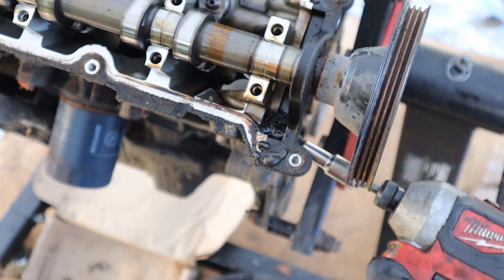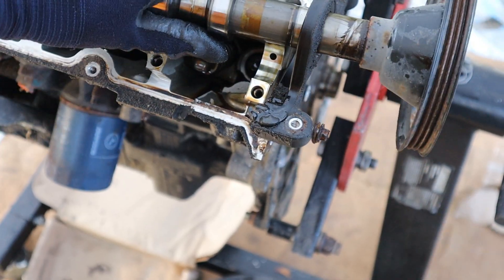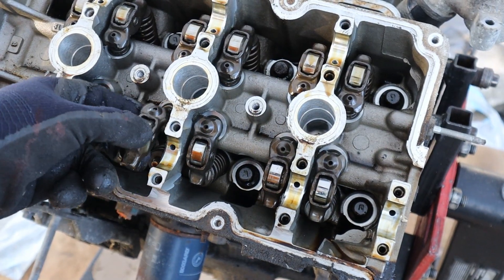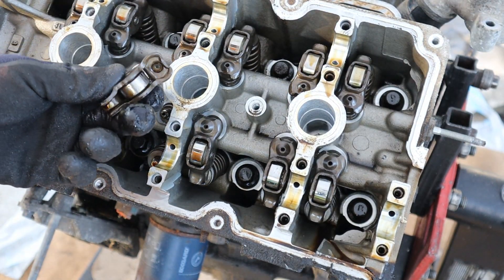There's a little 8mm bolt here. There's the exhaust camshaft. Here you can see the roller arms — there's nothing really latching it onto the lifter inside. Now the engine had two different designs: one was direct cam on bucket which would just press the valve down, and then there's this roller arm design.